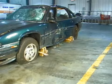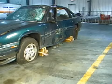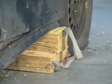Our normal vehicle on its wheels, if we were using step chocks, they would be sticking out a little bit depending on how low the vehicle is. If you notice with these devices, it's flush against the side of the vehicle, eliminating the trip hazard and yet still making the vehicle sit on a platform and be positive locking.